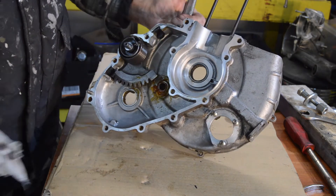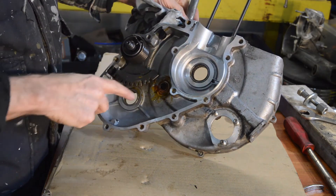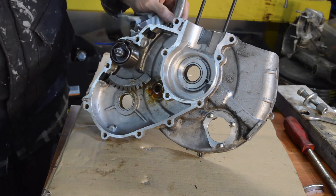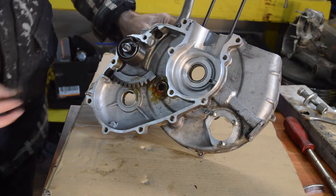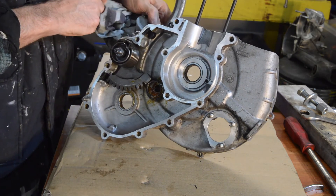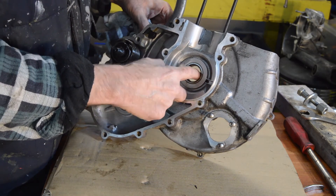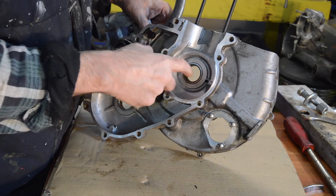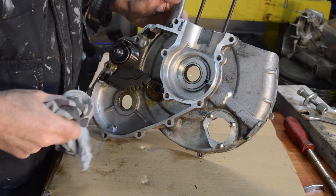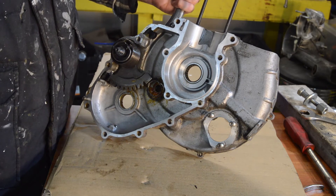The other side — again, everything is perfect. Ignore the grease; that's where the kickstart spring was seated, but the fact that that grease is still there indicates to me that this engine hadn't moved far. The flywheel side bearing is good — solid, lovely and smooth, all the rollers are perfect, no marking whatsoever. I won't be changing it. Normally I would, but really this is just so good, it would just be wasting time and money.